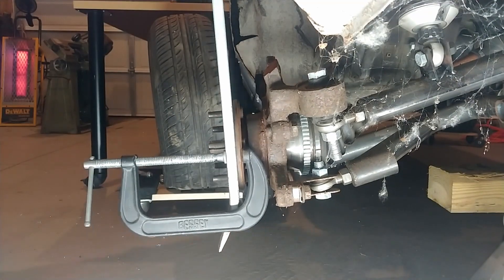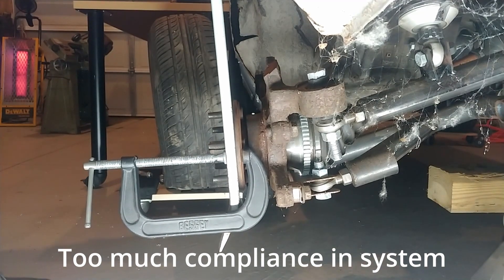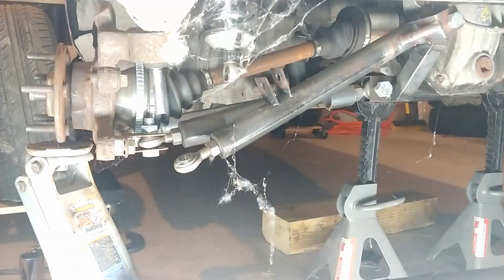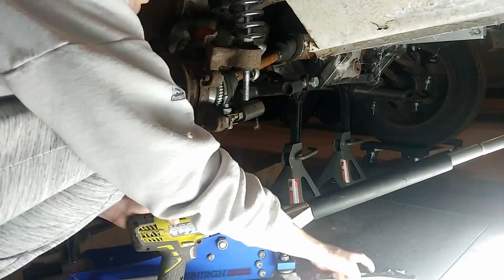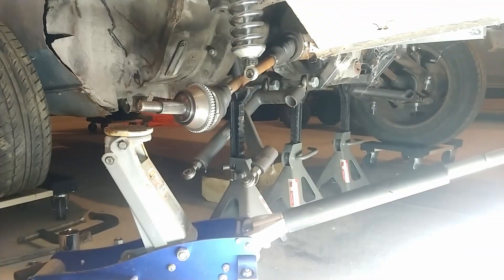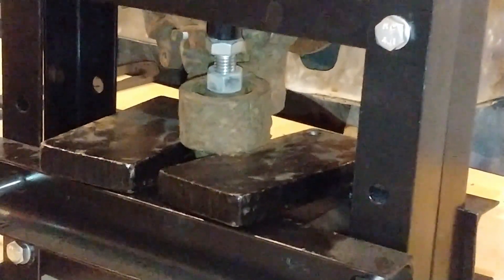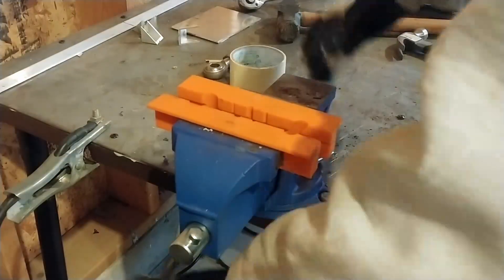This was a problem I discovered when moving the car — as I rolled it, it gained about 10 degrees of camber. Upon further investigation, the bushings were way too soft and needed to change. Also, since I redesigned the lower control arm, that upper arm no longer needs to hold things in place, so it can be changed to a heim joint. We had to press out the old bearings — they were trashy, horrible, and super soft.